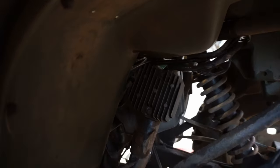I don't know if the wires are going into it wrong, or if there's a ground wire that's not supposed to be ground going into this the wrong way. Something's not working, but it's only when you turn on the ignition, so it's gotta be something weird. But we still get that one consistent spark every time you shut off and turn off the machine. All right, so I suspect it's the CDI again, and it could possibly be the rectifier.